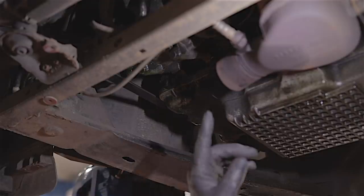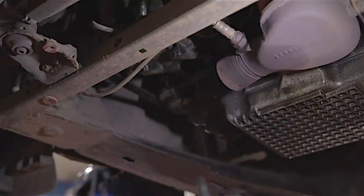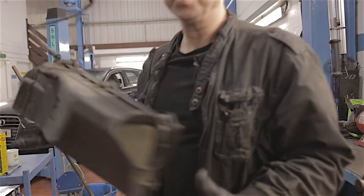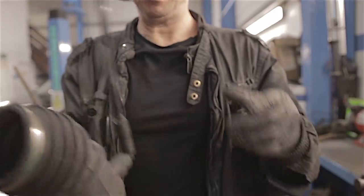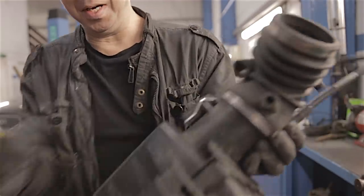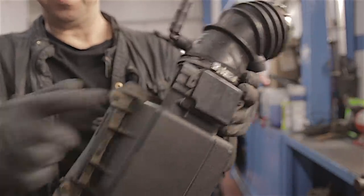Where the exhaust slides off the cat it really butts up against the subframe, so you've got to wriggle it out — it's a bit tight there. Underneath the bonnet you've got your air cleaner box to take out. The one thing to watch out for is there are a number of air pipes and breather pipes — you've got to be careful what you're undoing. Also the airflow meter wiring. Obviously remove your engine top cover, your battery, and the battery tray has to come out.